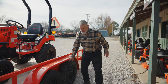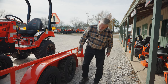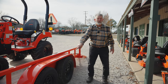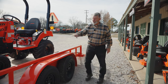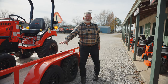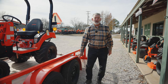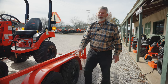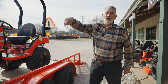I've seen cases where people overload their trailers — the front end is low — and one tire and wheel hardly touches the ground. If you have a trailer with brakes on the back axle only and the back end is too high with the front end too low, when you put your brakes on, they're not even working. So you've got bad tire wear, you're plowing air, and you don't have good control of your truck.